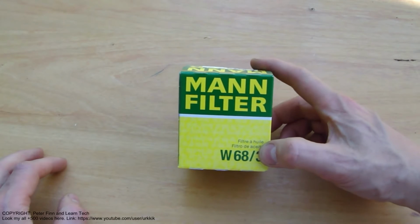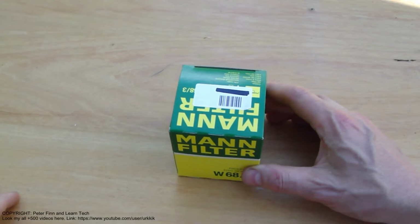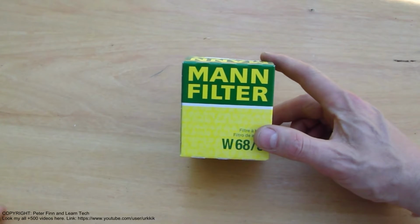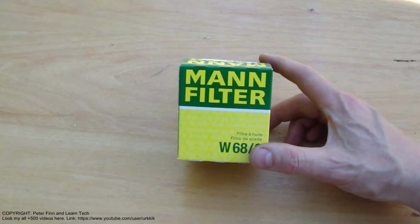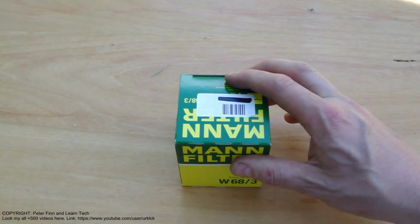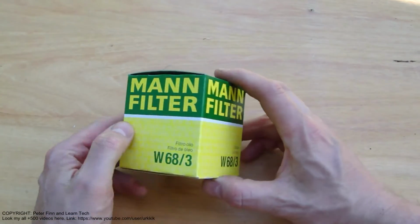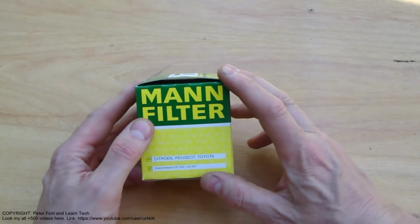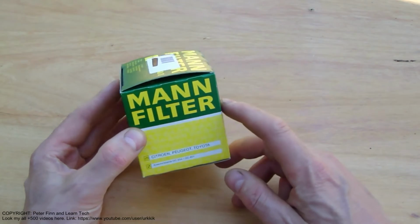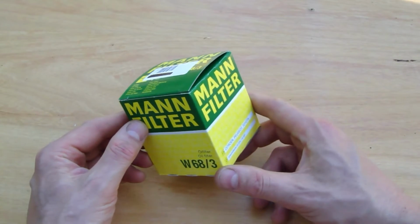Next I'd like to talk a little bit about this Toyota Camry's oil filter. There are really differences between those oil filters, and two oil filters are the best level that I can recommend. The first one is of course this Toyota's original oil filter, which is the best one, and the second best one is this interesting MANN filter which comes from a country, the name is Germany, and this MANN filter fits in this Toyota Camry gasoline engine, 2.2 liter engine, and also in Toyota Corolla engines.